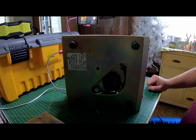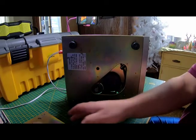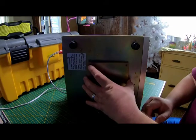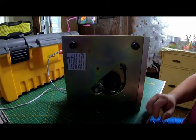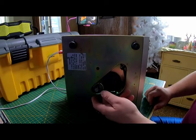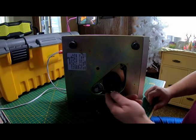I just had another thought — this Pioneer has a rather unique and very nice design. If you ever need to change your belt, there's this little piece here that is normally sitting right here, held by four screws. When it comes off, your motor and pulley with the belt are all right there, so changing your belt is very straightforward.